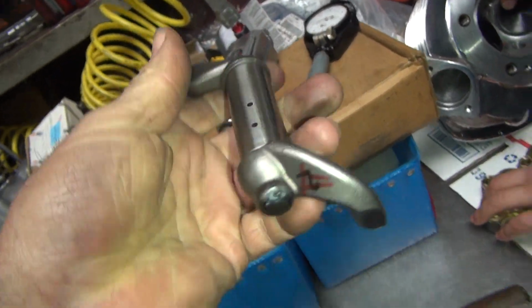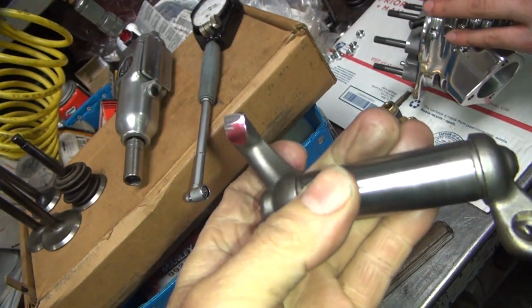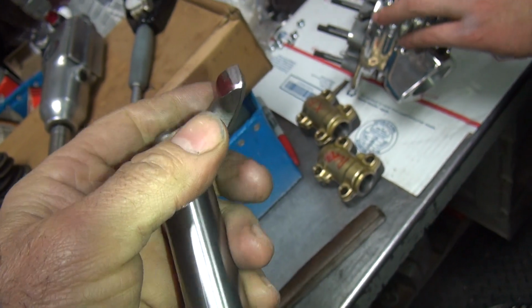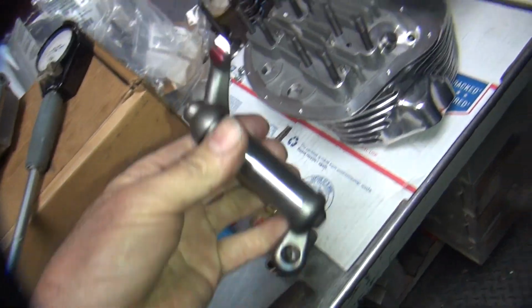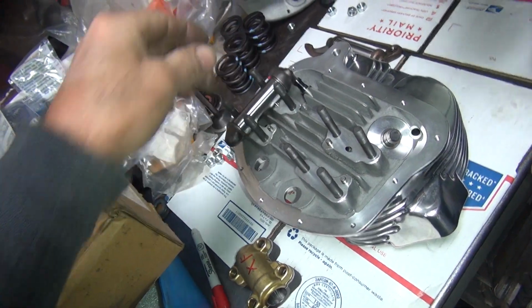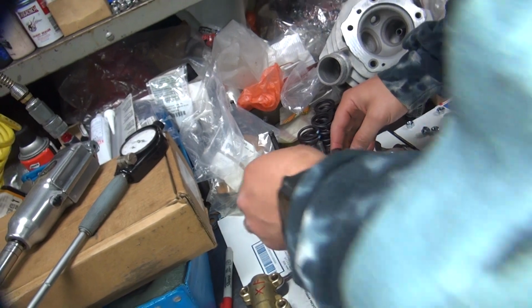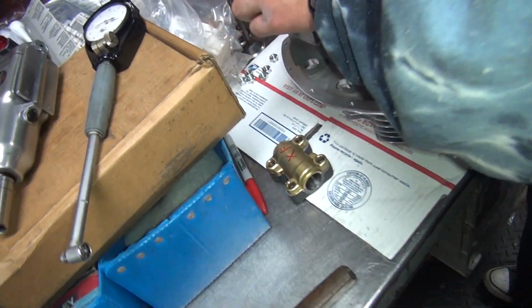It's got an F on its front. Yeah. So I did a quick grind on it. We shortened it up so it's more square. And I ground on here, it's way the hell off the angle, but I don't know if that's the grinder or the rocker. So I'm going to put that on, no, nope, it's on the intake. So how's it look? Is it pretty close? Yep. Let's run it. Run it for an intake.